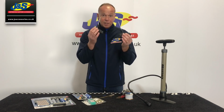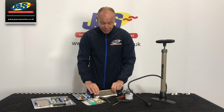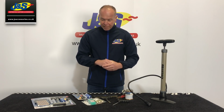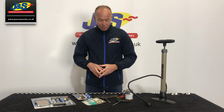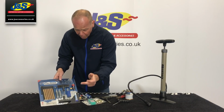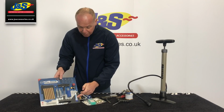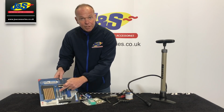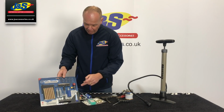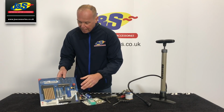So the basic kits have the insertion tool, the reamer, the actual bungs themselves, and some sort of rubber solution, rubber glue. That's what the basic kits have. The better, more advanced kits, like this one here, have the reamer, the insertion tool, the rubber bungs, the rubber solution, but then they have the cylinders to inflate the tyre after you've done the repair. This one also has a little regulator, so you can control the amount of air that goes in.